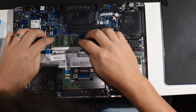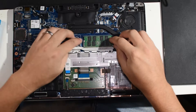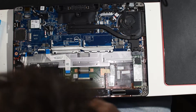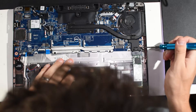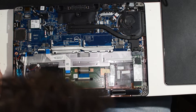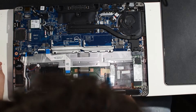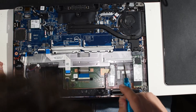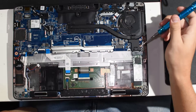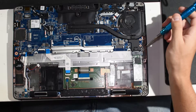You don't technically have to pull your RAM out, but I recommend it — set it somewhere safe. Then you're going to pull the motherboard screws out here and here, and then keyboard screws out here, here, here, here, here, here. There is a difference in length of these screws — where the M2x5 is, that's actually a long screw.